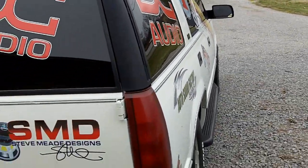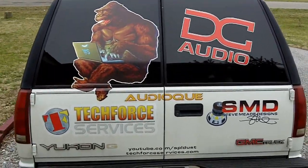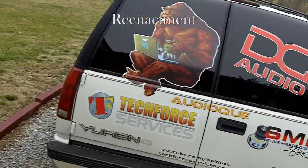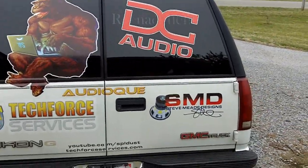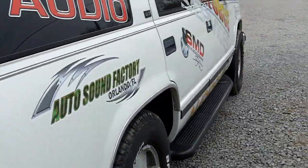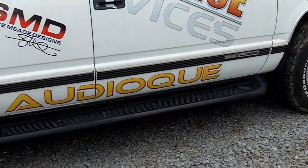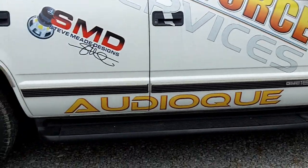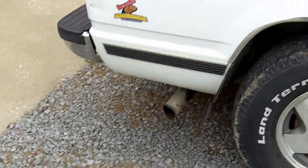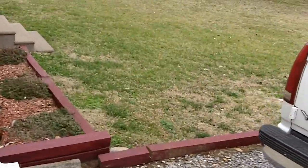What was happening is whenever I go about between 65-70 miles an hour the truck started swaying. Well, found out the sway bar bushings and everything was dry rotted on them, and a couple parts here and there. I think control arm bushings too were bad. $1,200 later I got everything pretty much fixed — all the bushings, front end alignment. Got everything fixed and bad news is it was still doing it, but not as bad.